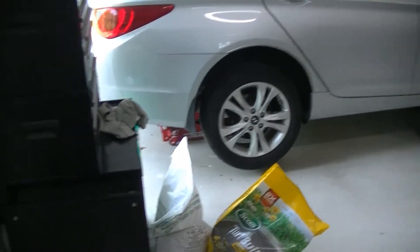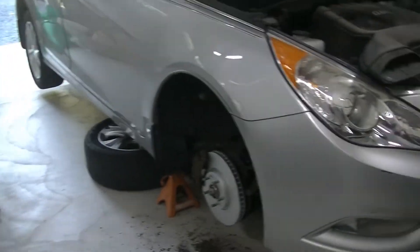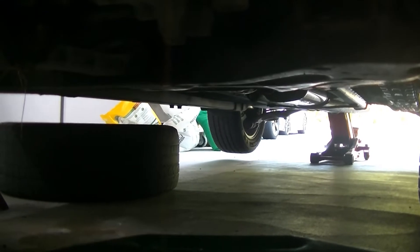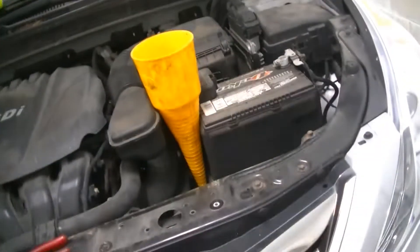We got the back of the car jacked up and it's just about level, so we can go ahead and start adding our fluid and performing the procedure to adjust the level. It doesn't have to be perfect — it's never going to be perfect when the car is up on a lift; it's as good as we're going to get it. I want to show you this transmission fluid while it's still draining. You'll see it still has a reddish tint to it — it is by no means burnt, and it doesn't smell burnt. So this transmission is definitely a candidate for a transmission service. Servicing this transmission will in no way damage it; it's only going to help it be more efficient and extend its useful life.